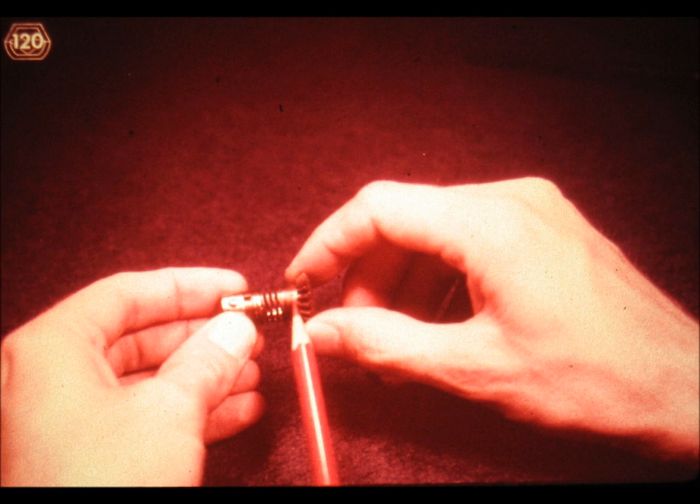Slide number 120. If your machine was properly taken care of before you got it, the clutch is completely dry, without any grease nor oils. Let us examine this tabulation governor clutch for a moment. The hub in the left hand is really a combination collar and arbor. You know that it was fixed on the operational shaft by the set screw, meaning it must constantly turn top to the front with the rotation of the operational shaft. As you try to turn the collar arbor top to the front, you notice that the clutch spring offers very little or practically no resistance, because this rotation, without also turning the pinion in the right hand, tends to expand the internal diameter of the spring, thus disengaging the clutch.